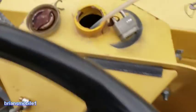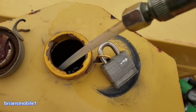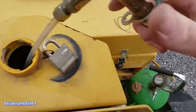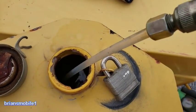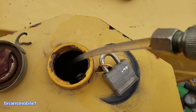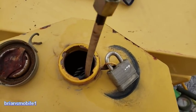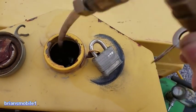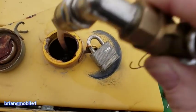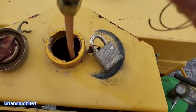This is an old roller ride-on compactor. Tank's a little rusty — you can feel it on the bottom. We've got a suction tank; if you have an air compressor and don't have one of these, you should get one. Fuel's brand new, just put it in. What color does it come out? Brown and chunky — looks like crap. I'm just stabbing around and it feels like a quarter inch of rust on the bottom of this tank. It actually died — it quit running because it blocked the fuel filter off. Had to pull the fuel line off and back-flush some of that garbage out.